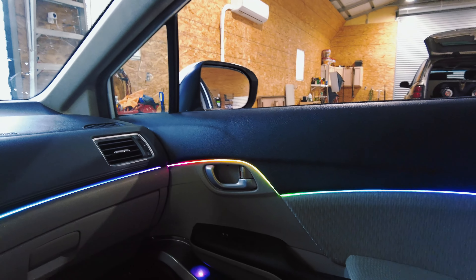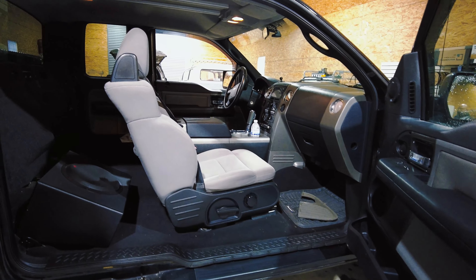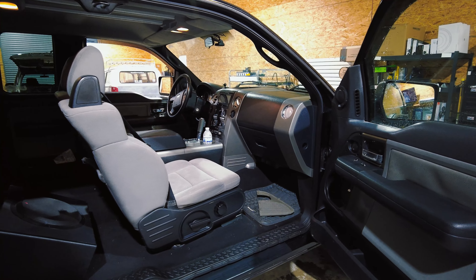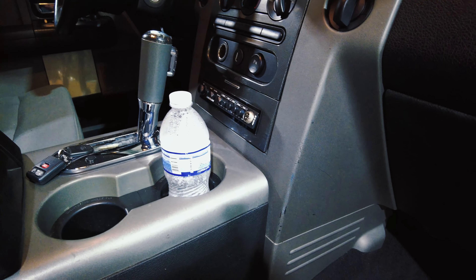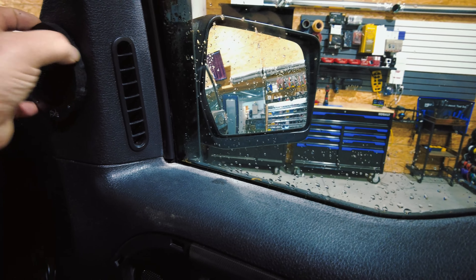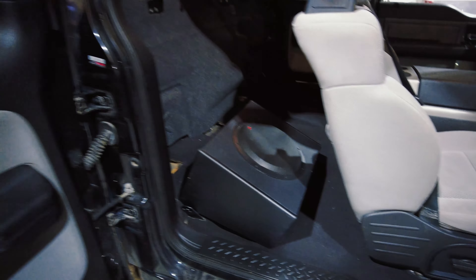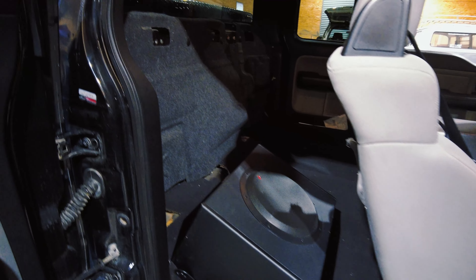It's actually a horrible idea for my kid - very distracting with the pretty lights that you can make change and do anything you want. So this F-150 is a customer of mine I've done multiple cars for - it's kind of become his project truck where he just wants to keep adding stuff. He already had me do a JVC double-din head unit, then wanted the AudioControl in-dash equalizer. He had PowerBass three-ways, so I squeezed that big woofer up there with the tweeter there. I still need to do some more work on how it's holding up on the side.